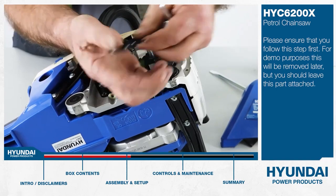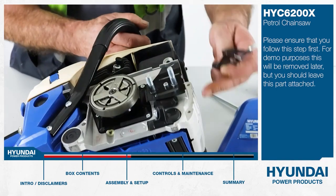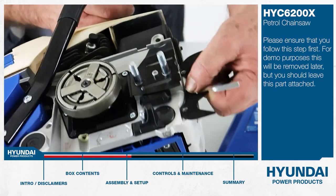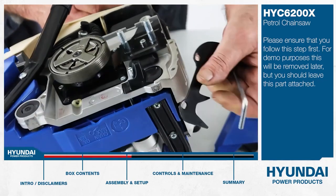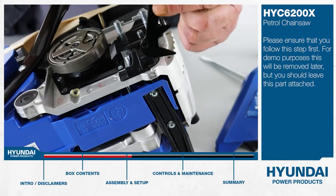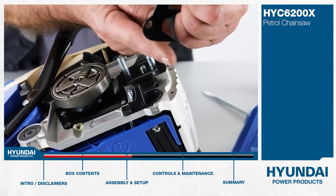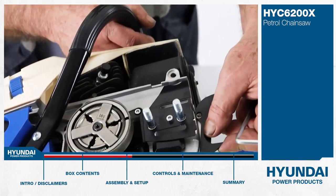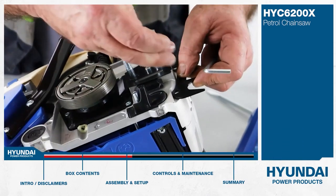Okay, so we need to fit the bump spike on here, and you can see there are 2 tapped holes in the casing. The bump spike goes on in this orientation. So if you look at it, you can see that there's a long sweeping curve and a shorter sweeping curve, but the long sweeping curve goes towards the top of the chainsaw. So I'll just place it in position.